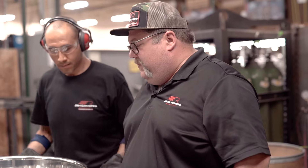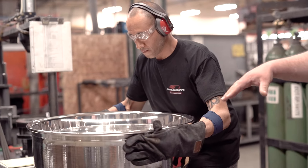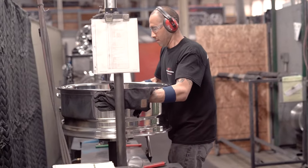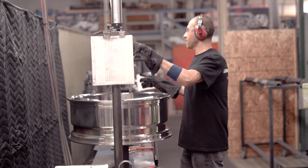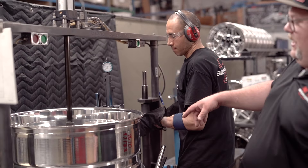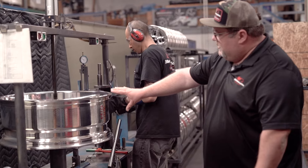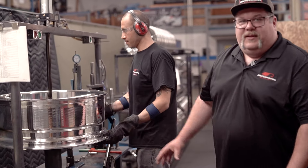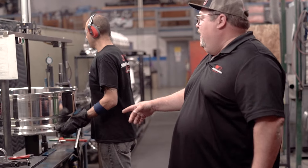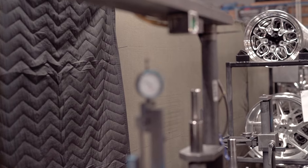He's got it together now — it's fairly shrunk but there's a friction fit. You can see how tight it is already because the air is cooling down the rim. He's going to come over and put on some gauges to measure and make sure the center is straight in the wheel so that it's not wobbly. The gauges are going to tell him if it's centered or not, and if it's not centered he's going to use this really long hammer.